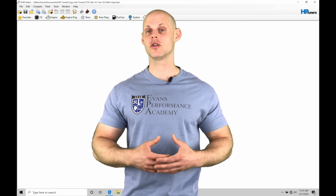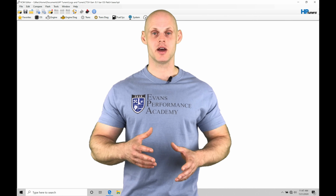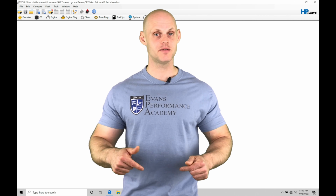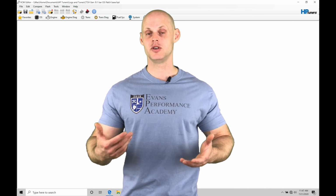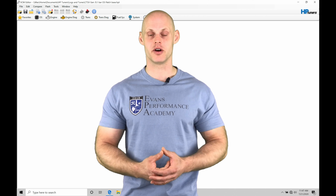Now in the last video we learned how to create our base calibration file, going and making the changes we need to in order to get our engine fired off. This video we're actually going to start the process of doing the fuel and spark timing tuning at idle, also looking at how to calibrate our idle control properly.